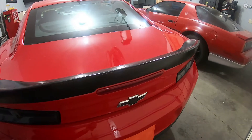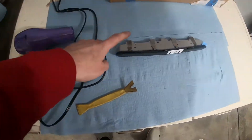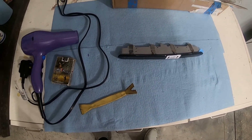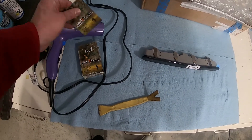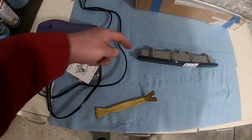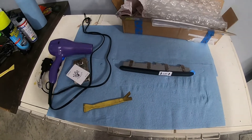Hopefully this should be pretty easy — the hardest part is probably gonna be scraping all the glue off. I don't have a heat gun so I'll use a hairdryer. I have the third brake light — I'll put the link in the description — plus a little pry tool and some playing cards. I'm gonna cut a point on one and hopefully slice it around to remove the adhesive and pull the light out, without having to remove all the covers underneath the trunk.